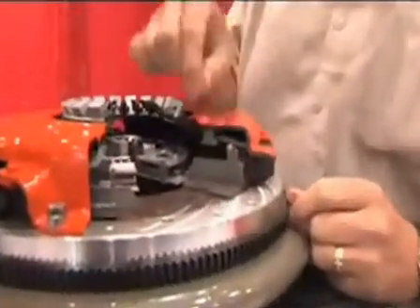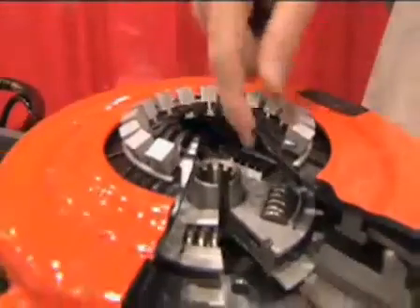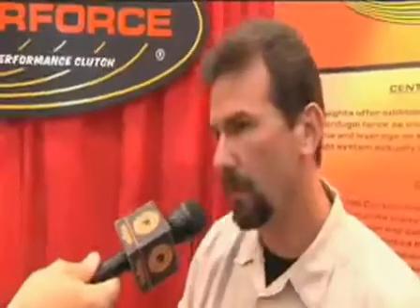Now, I know that Center Force has long been known for having a very light pedal pressure but a whole lot of clamp at the clutch. How do you guys do that? We do that with our patented ball-bearing technology, if you can see right here in the clutch itself. We use a ball-bearing internally, and we can change the internal friction of the clutch itself, reducing the internal friction, giving us a lighter pedal — we can change that pivot point and get a lot of clamp load with a soft pedal.